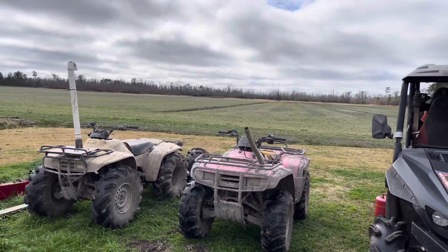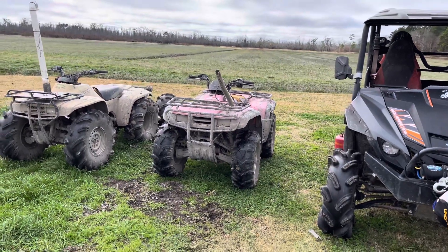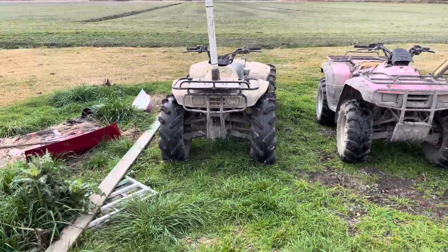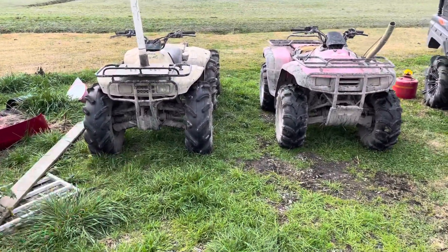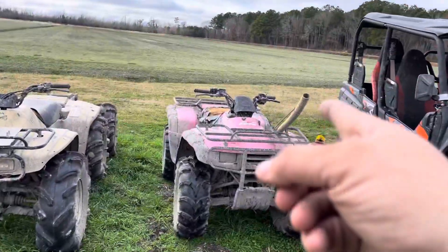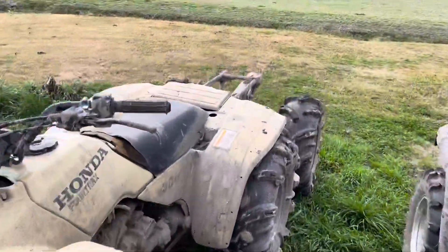We're going to start off with the Rancho. It's a 329cc, about 20.1 horsepower engine, compared to the 18 horsepower engine in the other one — I think it's a 282 or 286. You get a little more ground clearance with the Rancho because of the bigger tires, but it's not much. I counted about 12 inches in the front from the ground to the lowest point and 10 in the rear, and the other one is like 12 and a half, but actually has less ground clearance in the back. I measured it and I was surprised.